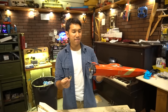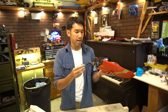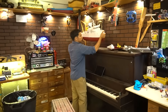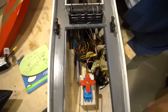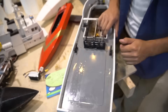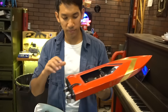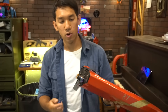So this was totally fun. I really wanted to test this concept of using a cheap brushless outrunner motor — the kind used for multi-copters and racing drones — to make a cheap boat. The problem with typical boats is you have to buy a boat, then buy a special stuffing tube, a universal u-joint coupler, and special boat propellers. That stuff isn't too badly priced, but getting it is inconvenient. Meanwhile, in the drone industry you can buy the same stuff for pennies on the dollar. That's why we went with the outrunner approach, and I'm so glad it works well — it opens up a lot of doors for people to design their own boats.